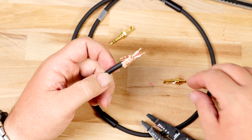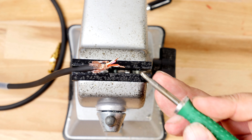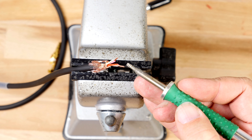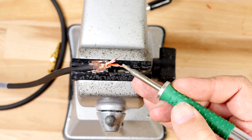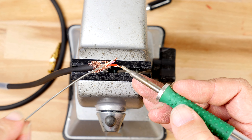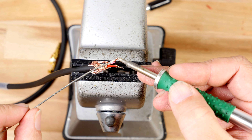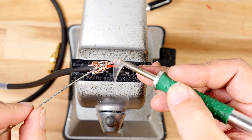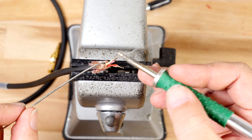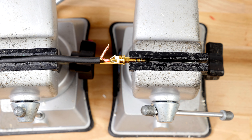As we only need two wires and the shield, I will be combining the red and white wire into one, and the pink and the cream wire into another wire. Take your wire stripping tool and strip the wires back approximately a quarter inch. Now I've twisted the red and white wire together and the pink and cream wire together.